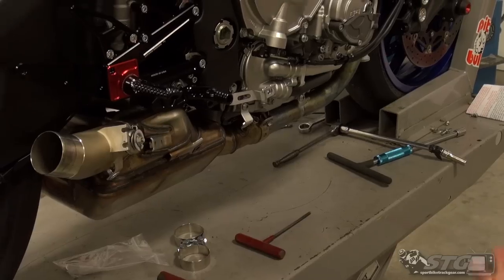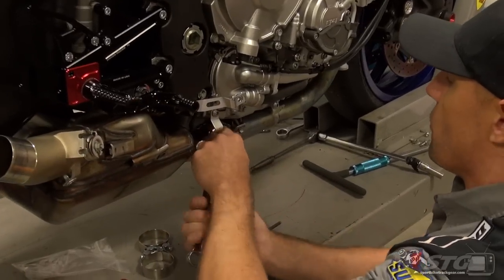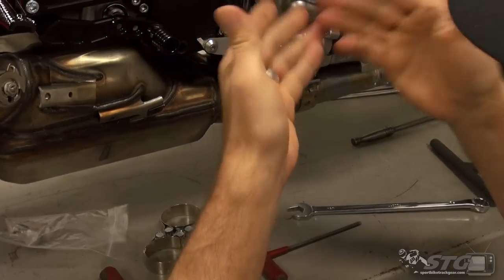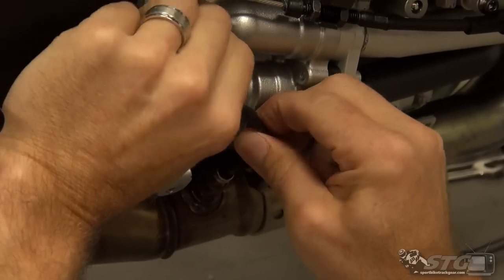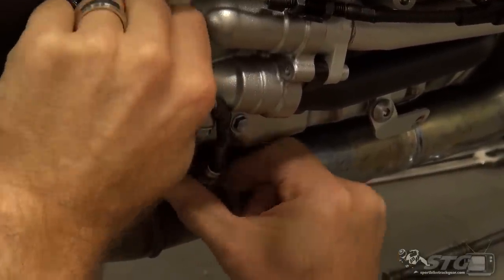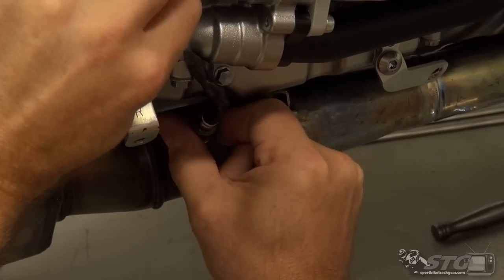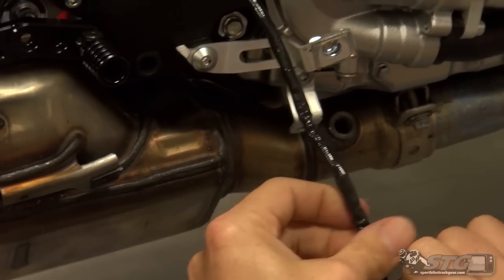Now dealing with the O2 sensors — I've put five exhausts on this bike already, so you guys already know I'm going to twist the wires. After all those installs, we still have no issues. Instead of going through all the hassle to pull everything apart and disconnect this, I like to take the stress off down here. I try to really twist the wires more in the middle and wind it as I go, so it's the entire wire that's being twisted and there's really no tension on it. Technically, should you do this? Probably not. However, this is something I've been doing for over 20 years and never had an issue.